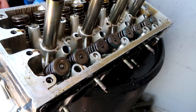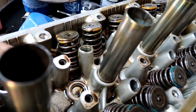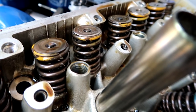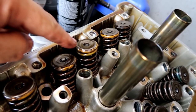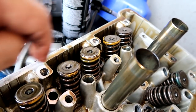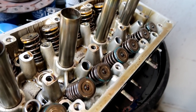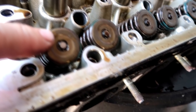On a side note, this is a cylinder head we took off an S2000 — it's an AP1 head, a 2000. You can see pretty clearly the difference in height between the valves and how much the tip is sticking out versus the others. This is one of the reasons we recommend you do the retainers. What happens is the retainer is actually bending up and folding — those two light spots are where the rocker is contacting the retainer. When the retainer breaks, everything falls apart and the valve drops into the cylinder, which usually wipes out the whole motor.